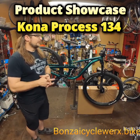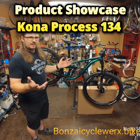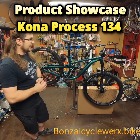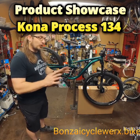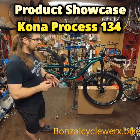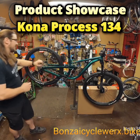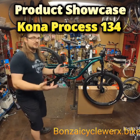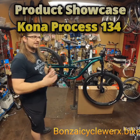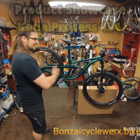The brakes on this bike are — Alhanzo, something like that — it's a knockoff brand. I get it, parts are hard to get, especially trying to keep a certain price point. So I'm going to lovingly call these brakes 'Aloy' brakes because I've been playing Horizon Zero Dawn. These Aloy brakes are two-piston. You have a 180mm rotor in the front and 160 in the back. They seem to stop well, good stopping power. If you start going downhill more — maybe go to Spider Mountain, something like that — you may start wanting a better brake. At that point, upgrade the brakes. Everything else on this bike is solid.